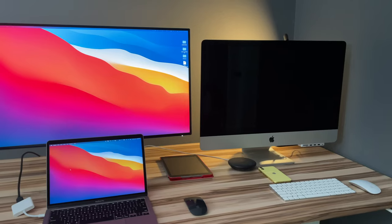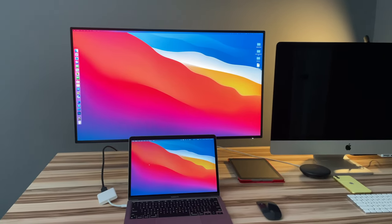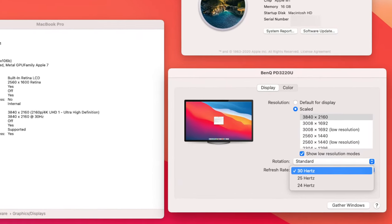You may be thinking, yeah, that is good, that is all I need — well, good for you, you can skip ahead. But if you have a fancy Thunderbolt monitor like this BenQ PD3220U, the M1 MacBooks will only display 30Hz. I did try to manually set the refresh rate but there was no option above 30Hz when connected this way. This exact same issue also happens with DisplayPort connections through a dock — no 60Hz options in display preferences. But all of this works correctly on the i3 MacBook Air with HDMI, Thunderbolt, or DisplayPort, so there is no issue with the cable, dock, or monitor. For now I can use an adapter with HDMI for desktop use, but I am not able to use another dock that I really want to, and this definitely looks like an M1 Mac issue.